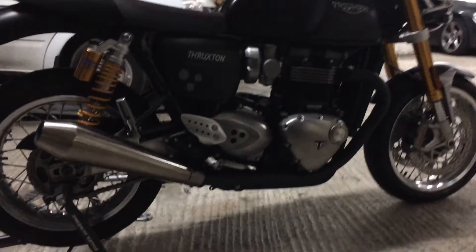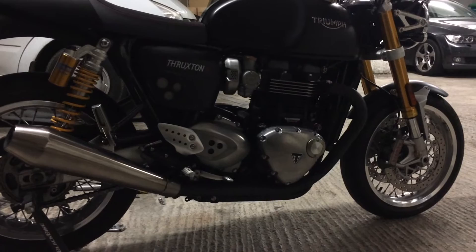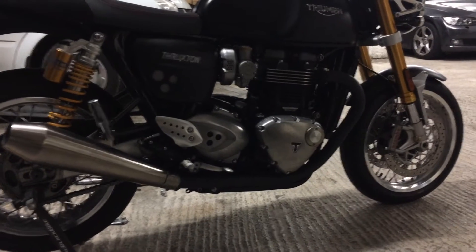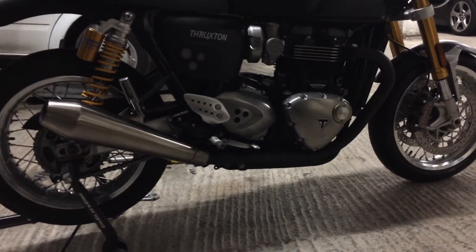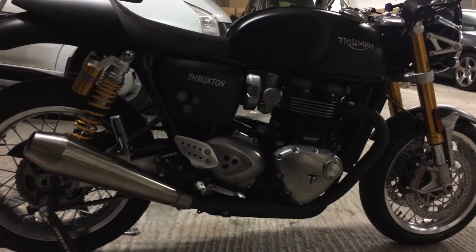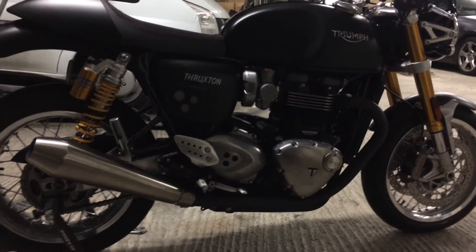The reason you can get away with that on this bike is that the rear catalyst creates enough back pressure and you don't actually need the silencers. It doesn't create a huge amount of obnoxious noise — it just adds that little bit of deep resonance to the exhaust note. You're also saving a lot of weight and it's just a shorter profile for the look of the bike.